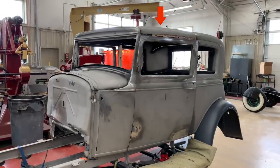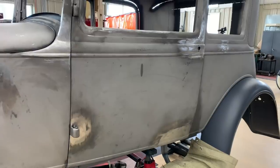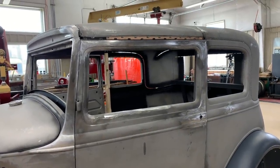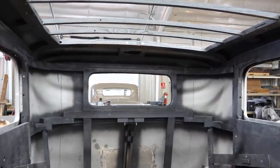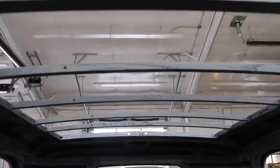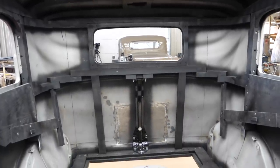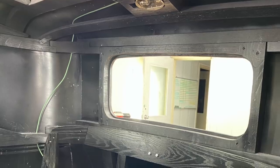See this hump right up here? I don't have the shape exactly right, and I'm a little bit low here where I welded it back on, but I have no top wood in it yet. There's no body wood in it other than the B pillars and that little strip of top wood so I could tie the side together. So I'm starting to get the wood put in the car. This is where I got to the point of I just fitted every single piece of wood, painted behind it, and then painted each piece of wood also. That way, behind everything, I'm not going to have rust. When I paint the body, I'll go ahead and shoot this all again.